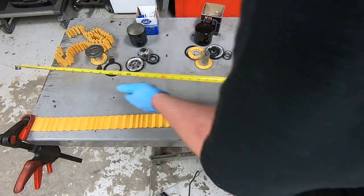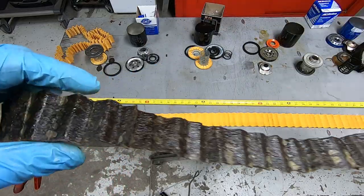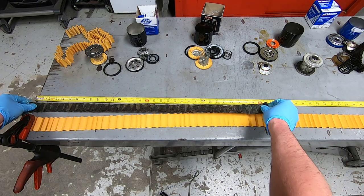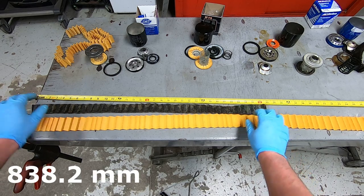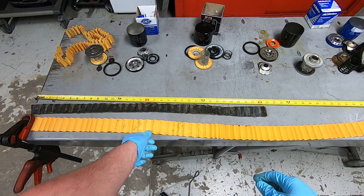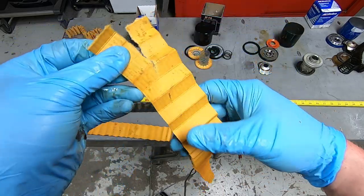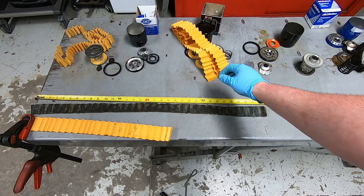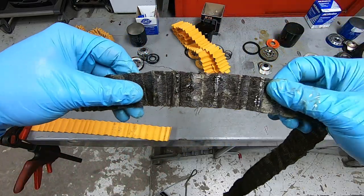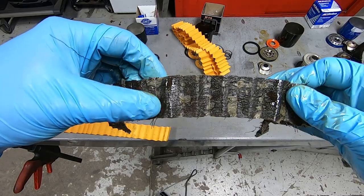Let's look at it versus the Harley Davidson. The Harley Davidson is a different type of material, where we had peeled it back, and it's like two different thicknesses of fabric with a metal backing to it. Here we see that it's 33 inches long. The S&S is a very paperish material, definitely a paper type of material, which is interesting. Whereas the S&S is paper and the HIFLO is paper, the Harley Davidson is a metal backed dual fiber type of filter.